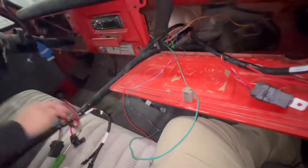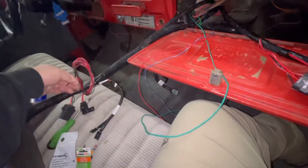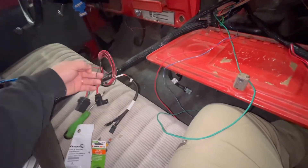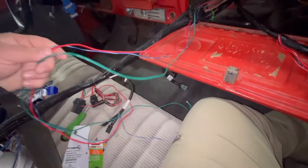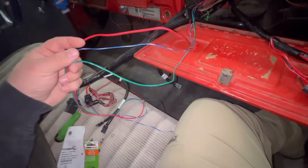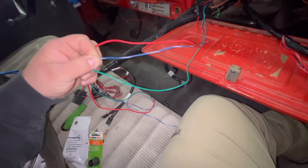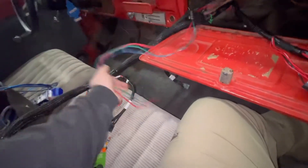Now this has the flying leads, as we're going to call them — a couple extra wires. This is switched 12 volt and ground because it is red with a white stripe. And then you have these three wires that come in with it as well. This is the fuel pump trigger relay — what's going to trigger my relay for the fuel pump. The blue is the tach signal, and then the red is 12 volt battery, so 12 volt constant.